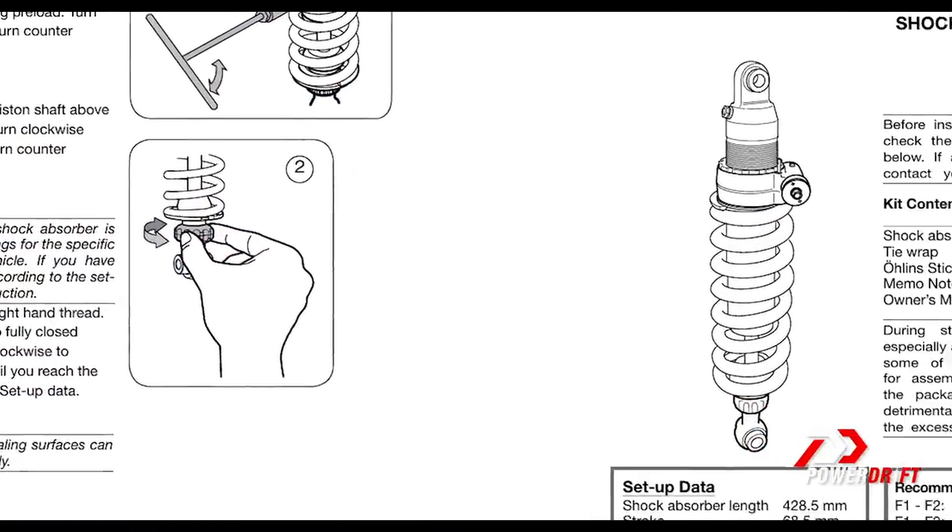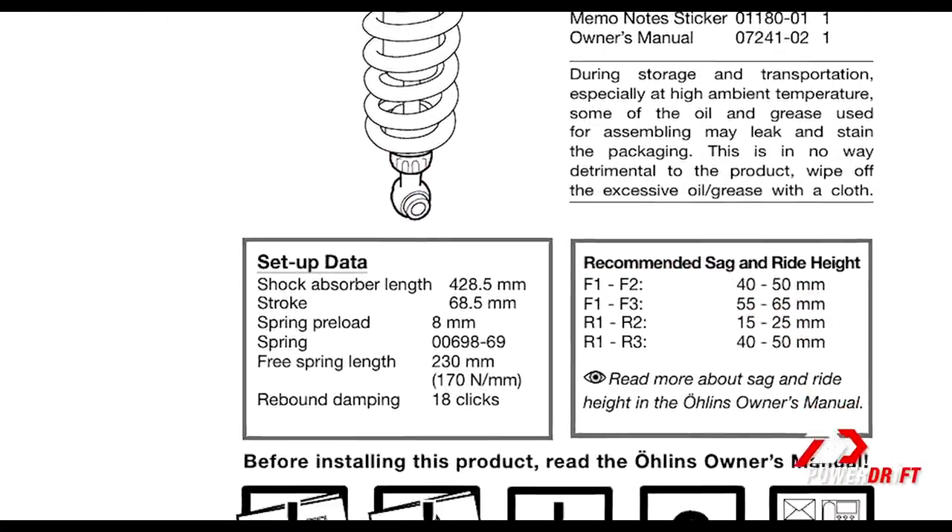Rebound then takes over, which is the topic we'll cover in the next video. Now if you have a motorcycle with adjustable compression — at the front, rear, or both — it's totally worthwhile to mess with the settings. Take a notebook and write down the stock setting, usually in your manual. If you have fully adjustable suspension, the manual will typically have a comfort setting which is the most absorptive and pliant, as well as a sport or race setting which is firmer, assuming you're riding on a relatively flat surface but loading the suspension aggressively with brakes and throttle.